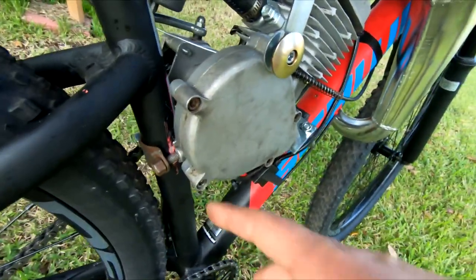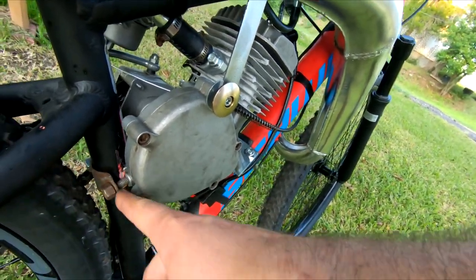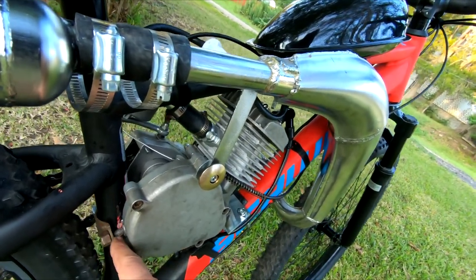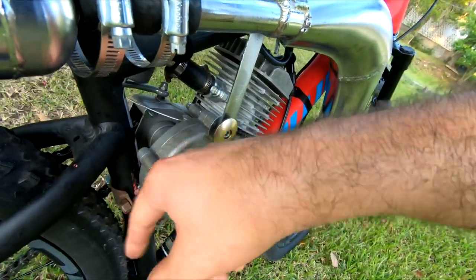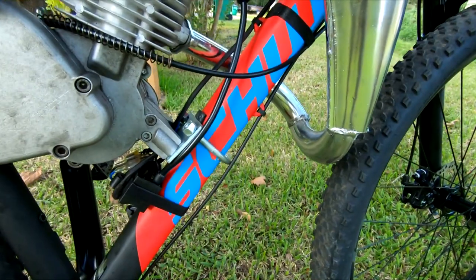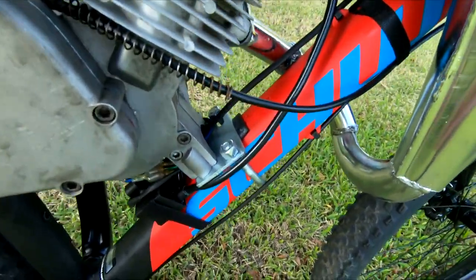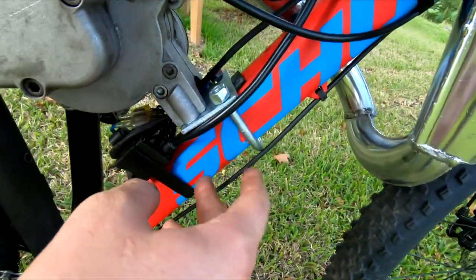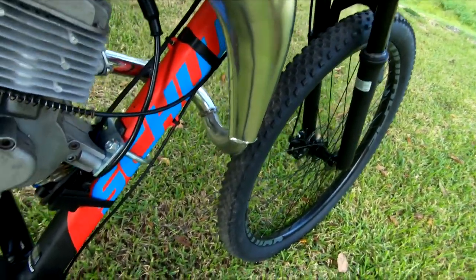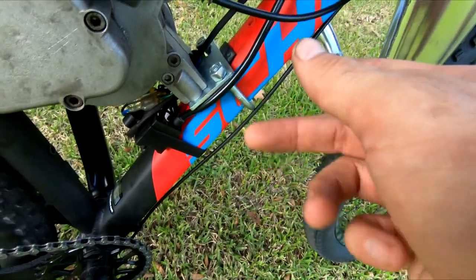Mounting is not pretty. At the rear, I've got to touch up the paint. I had to slightly widen the mount because this is a 33-millimeter seat tube — the seat tube is thicker and wouldn't quite wrap around the cradle, so I took a sanding wheel and removed a little bit of material until she fit. At the front, I'm not proud of it — it's just how it's got to be. Universal adapter with a little bit of rubber under the mount to prevent it from eating into the frame. The U-bolt is not great either because this is not a square tube and not a round tube — it comes up at an angle and then squares off. I'm going to come up with something cleaner, less stress on the frame, but for now this will work.